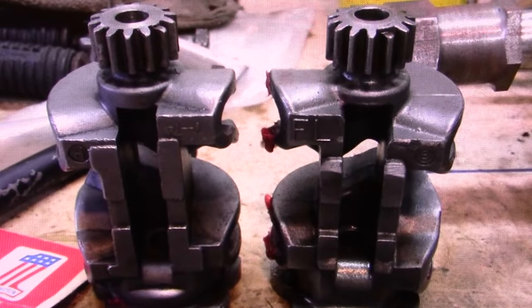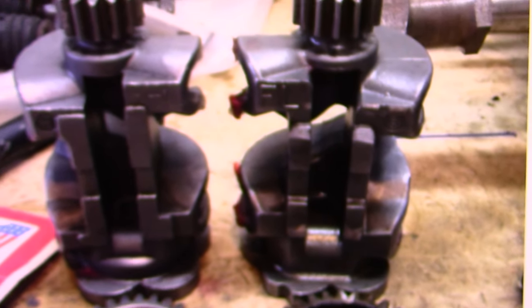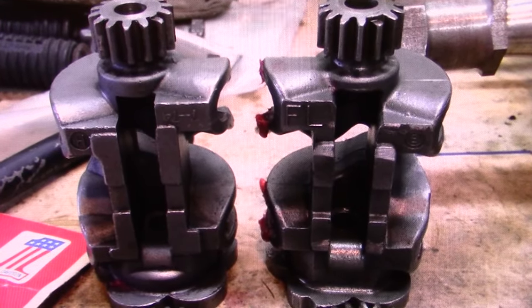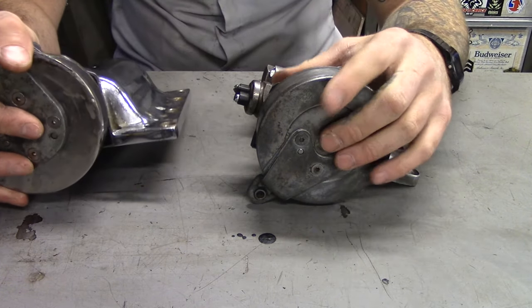That's how you can get that reverse shift pattern. The other telltale signs are that dash-74 part number on the FX and then FL on the FL shift drum, even though they are both cast and machined drums. So if you're looking for an FX shift drum, make sure it meets all that criteria. They're definitely more rare than the FL style shift drums. So you've got to check your part number.